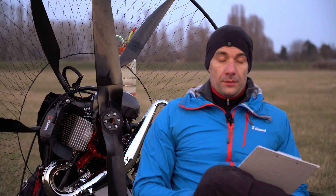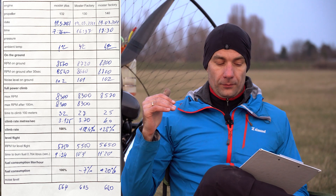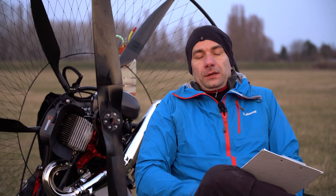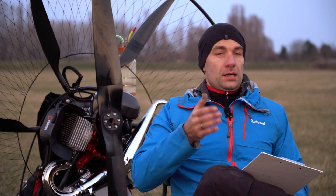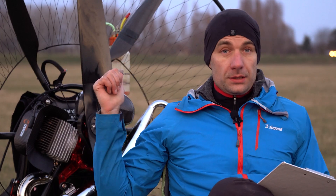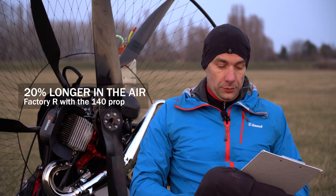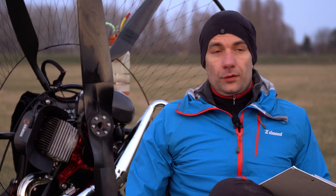Fuel consumption. I was surprised — the RPM to maintain level flight was the same: 5,700 with the classic Vitorazzi Master Plus, and 5,650 with this one. Despite having the same RPM for level flight, this could fly 11 minutes and 20 seconds to burn that bottle of fuel, which is 20% longer — 20% lower fuel consumption. Yes, it is 20%.